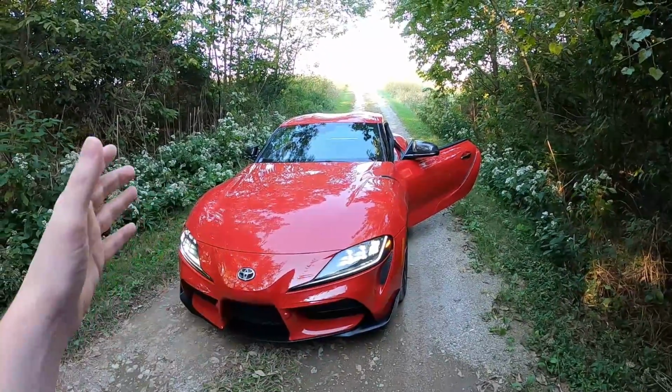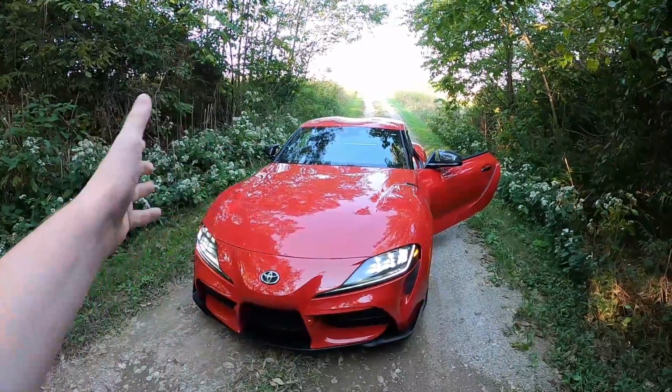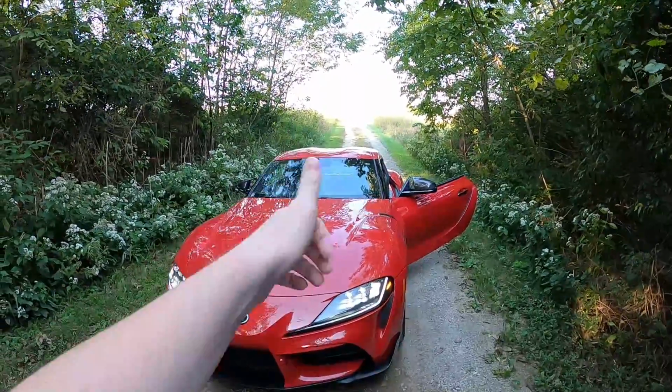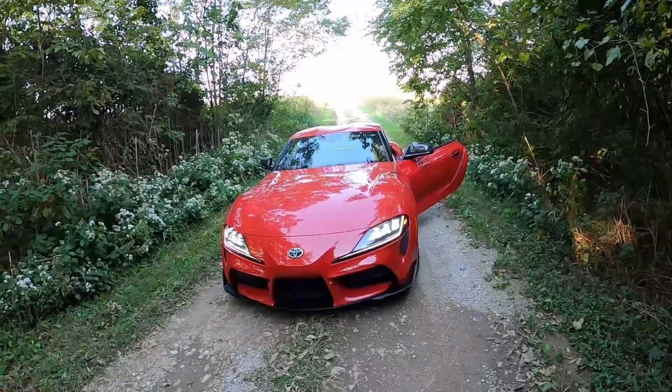It seems like if your E content is actually at E85 and if the 93 has about 5% ethanol in it, then 3.6 to 4.0 gallons of E85 and the rest 93 ought to do you right for the E30 tune, that is.